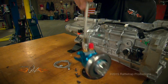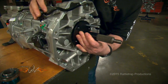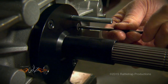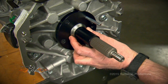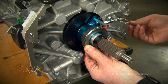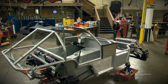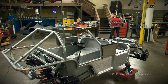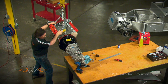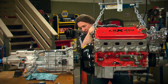The next step is to mount this hydraulic throwout bearing to the transmission using the supplied adapter. This is one of the key elements of a modern clutch system because it completely does away with any mechanical linkage and allows you to push a heavy clutch without wearing your leg muscles out. Once the transmission is prepped, it's just a matter of bolting it to the engine — and this is where having an engine hoist is really nice because these big Tremec transmissions are heavy.